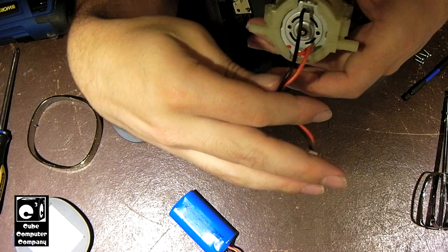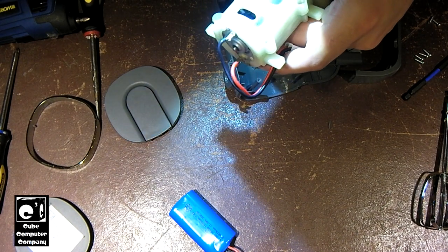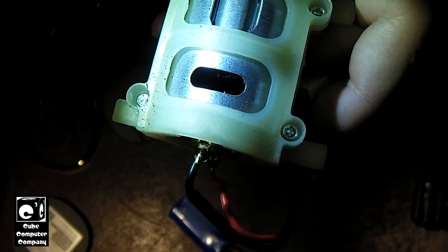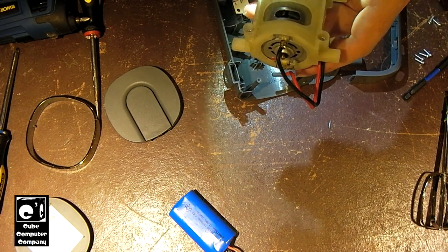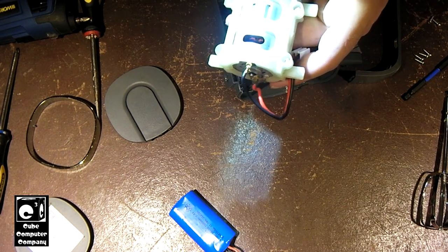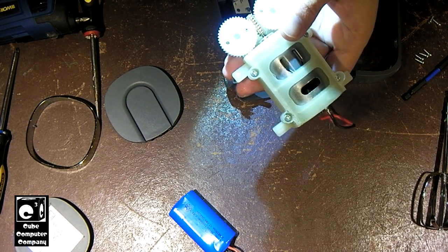I can smell it — it smells like it got hot. Those windings look pretty dark around the commutator. This motor was intended for a high-speed, not super high-torque application. The designers made a bit of an error here — they should have used a motor with a higher turn count on the windings for lower speed but higher torque. If they had done that, this mixer would have been much better. The only issue then would be getting that worm gear off to install it on a different motor, which could be doable — something I'd have to investigate off camera.